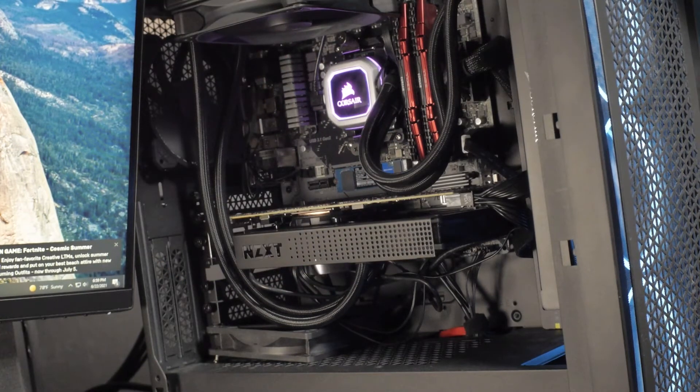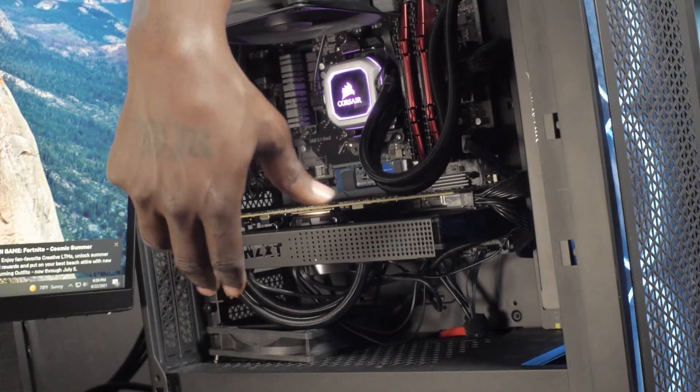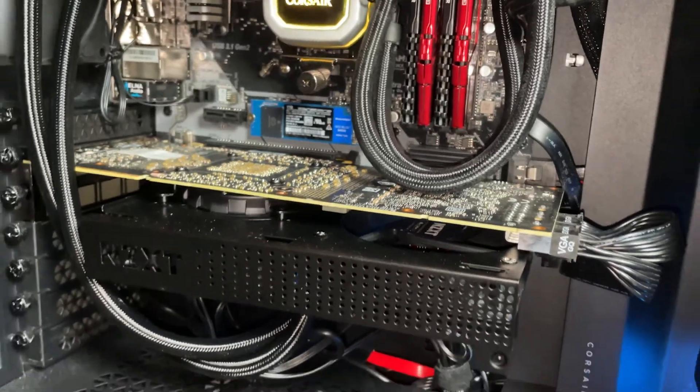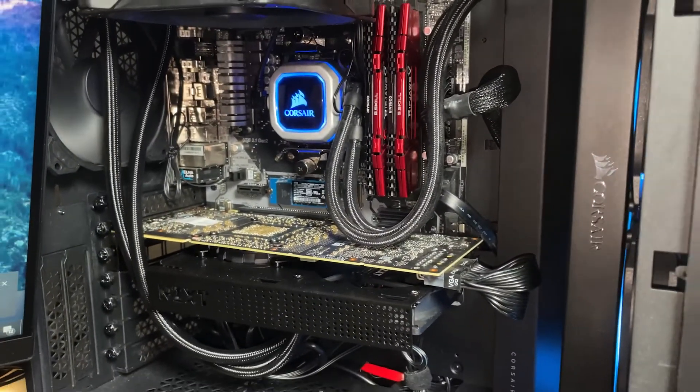Ultimately I had to add another fan under the graphics card to blow on the memory and VRMs — the parts that weren't being cooled by the included fan. Most cheaper lower-end cards only have RAM and VRM on one side, but the 2080 Ti has them on both sides, and this kit doesn't include a fan to cover the other side. I also put heat sinks on the VRMs and RAM on that side — just some $8 ones from Amazon. The thing that hurt my airflow the most was accidentally buying a 140mm radiator instead of a 120mm. My case only fits 120mm in the back, so I had to put the AIO on top, move my 240 to the front, and now most airflow coming in through the front is obstructed by the AIO. That also hurt VRM cooling.